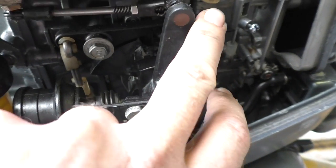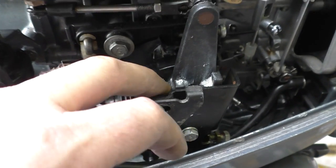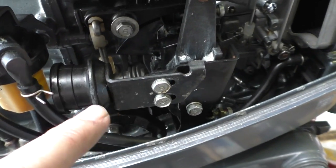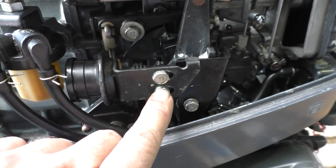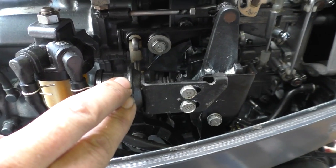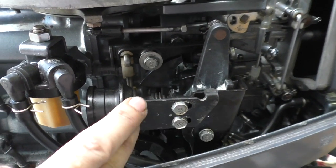What you'll also notice is that as you advance the timing, the idle speed will increase, and as you retard the timing, the idle speed will decrease. So once you've got your timing correct to the spec, you may need to adjust your idle to get that into range as well. As I backed the screw off, it got to about top dead centre and then stopped moving. What happens is, as the lever tries to go this way, the top can come this way because I've backed that bolt off, but the lever actually hits against the plunger for this dashpot, and that stops it going any further. The dashpot's mounted onto a bracket, and the bracket has these slots in it. So if I loosen these two ten-mil fasteners, I can move this bracket further to the left, which will allow this lever to come further into the retarded position.